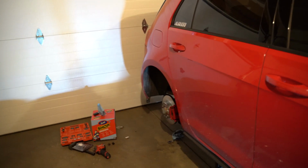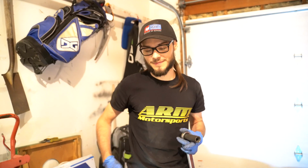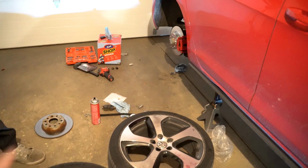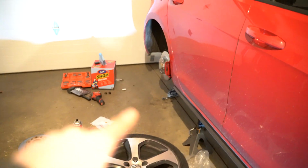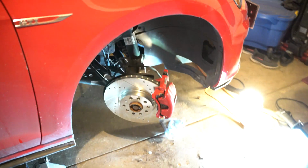Plus 90 degrees. Do you think 90 is roughly 66 plus 90? No, but we're gonna say it is. So we did 90 foot-pounds for the rears. We're gonna call it good unless Vincent dies. It's whatever. That's on me then. Yeah, good luck on those rear ones. They sucked. Front ones weren't that bad.